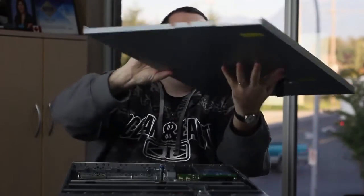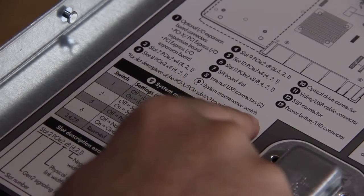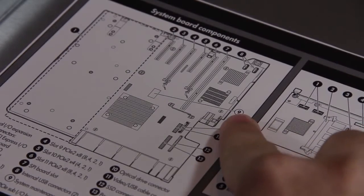It's quite easy actually. HP had enough forethought to think that kind of stuff could happen, and they built it right in. This is one of those low-tech solutions. We don't need to crack anything. All we have to do is know how the motherboard works and find a little way to bypass it. If you take a look on a DL580 or any of the similar rack servers, if you flip up the case, you'll find there is a set of server drawings right on the cover. The area you're looking for is called the system board component interfaces. There's a set of drawings with numbers pointing to it, and you're looking for the item that says system maintenance switches. Especially on the 580s, it's a really big drawing, and it's section 9 of the motherboard. Right underneath the system board components drawing is a section called the system maintenance switch. It's a table basically.